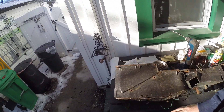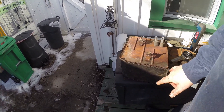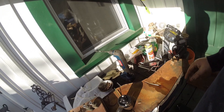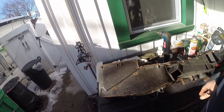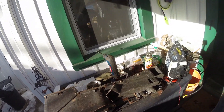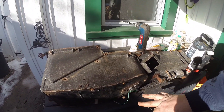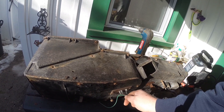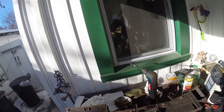I got the heater box all back together. I cleaned it up and reassembled it. When I put the metal plates on the back, I put in some weather stripping foam to seal it up - there was some there before but it disintegrated because the thing is 57 years old. I also put weather stripping on the flap inside. I'm going to test the resistor to see if the various fan speeds work. And there is low, medium, and high. I got my three speeds and that is the original blower motor - it just needed to be cleaned up.